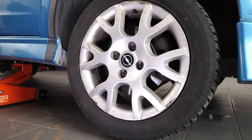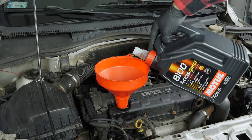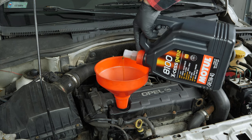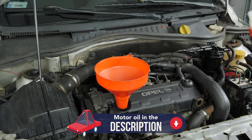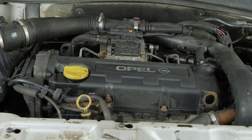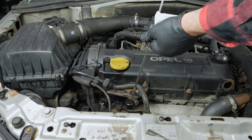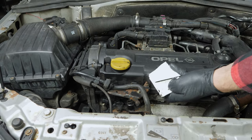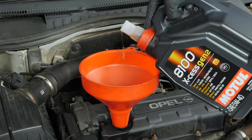This can only be done when the vehicle is flat. Add the oil into the engine, beginning with 90% of the suggested amount — this leaves a large enough margin to adjust the level appropriately. You can find the exact quantity of oil recommended for your car in the tutorial's description. Close the oil fill plug, start the engine, and let the car run for 30 seconds to fill the oil filter. Remove the oil gauge and wipe it down, plunge it back into its sheath, then remove it again and check the oil level. The optimal level is near the maximum, but never go over it. Based on the level indicated on the gauge, adjust to reach the optimum amount.